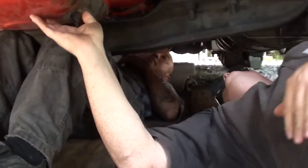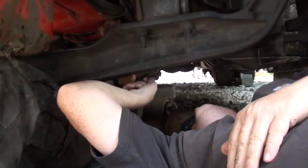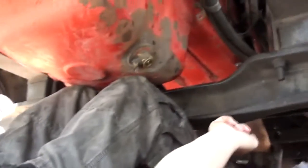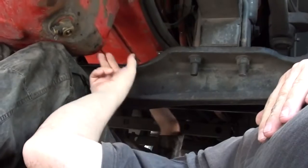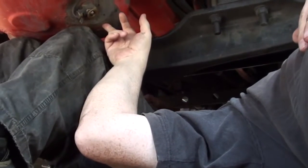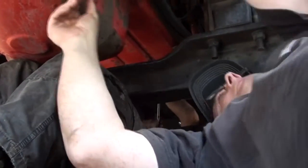All right. There's about a gallon or half a gallon of oil or so in the top of this pan, in that catch tray up there. So you're going to have to leave that up high, and this end has to come down first, so that it can drain into the bottom end of this. Otherwise, it's going to be a big mess back there. So you need to hold that up. Yes, sir. And while we take this one out.